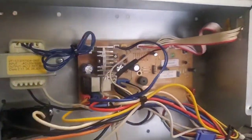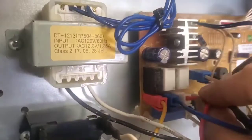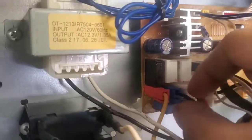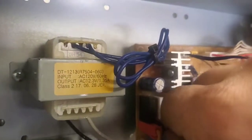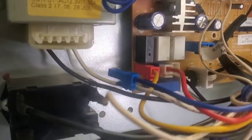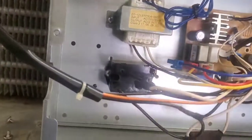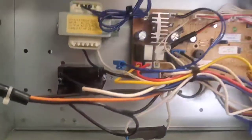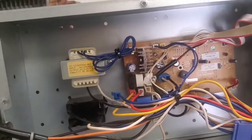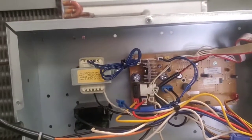There's only one way to manually defrost one of these freezers, other than unplugging it for a day. This wire is the evaporator fan, and this wire is the defrost heater, and this wire does nothing. We unplug the evaporator fan and plug the defrost heater into the slot that the evaporator fan belongs in. But wait — the compressor's still running. All you can do is just pull the wire off of the relay. That is what you have to do to initiate a manual defrost on a Blue Air freezer, because they just didn't see fit to put any provision in there for that, even though all of the competition did.